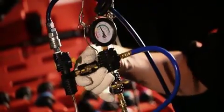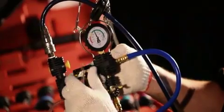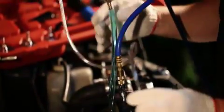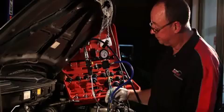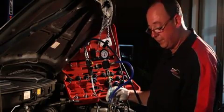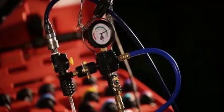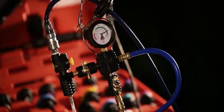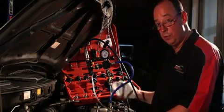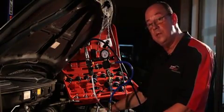That's all we're going to get. I'm going to hold onto this hose, shut this valve here, and open up this valve here. You can see instantly we're charging coolant back into the system. This will evacuate any air pockets — you can still hear the air coming out of this system, purely because the coolant is coming into your cylinder block and into your radiator. You can still hear the air coming out of the line, which means we've still got product going in. The radiator hose is starting to fill out again.